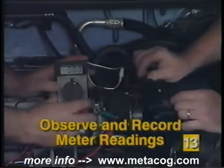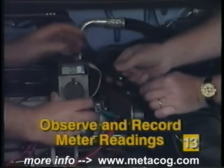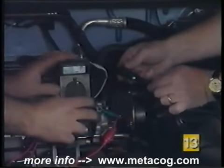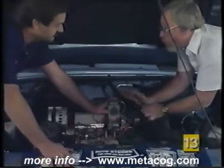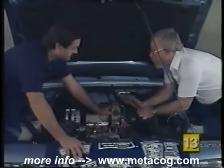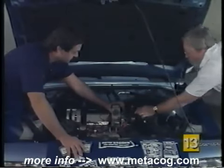And our light, if you can hold that over here a little bit, Jim, our light is just steady right now. So that's right. That's very common on really late model mass airflow sensors because they don't produce any reading at all until air is actually blowing across it. So if I go start the engine now, we should be able to get that type of a reading. Okay, let's try it.